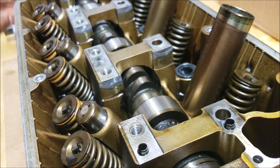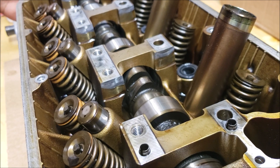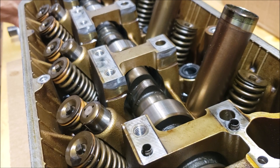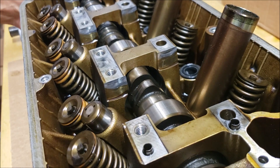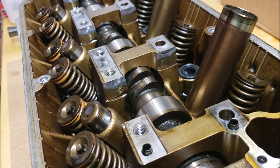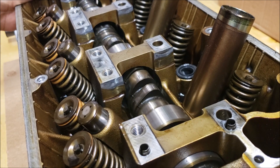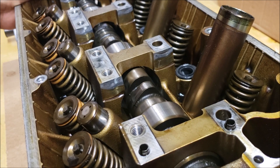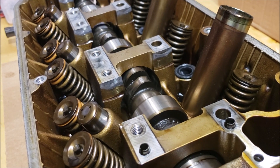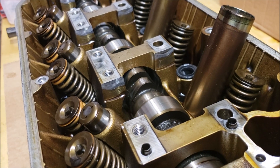See how close and tight this is already — there's really no room, and this is a stock camshaft in here. If you don't hold the cam in the right way it already touches the casing. So there's just not a lot of room to increase lift or to increase the camshaft size overall — very tight. You actually have to wiggle it up and down just to get it in because the lobes already hit the casing unless you wiggle it.